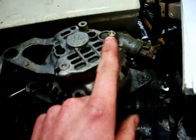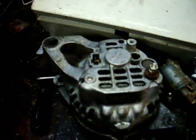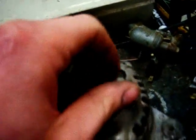For the main output cable to the battery, you need to use a heavier duty cable — something nice and thick. It has to be rated to handle whatever your alternator output is. This one's a 50 amp alternator, so you need 50 amp DC cabling. For an 80 amp alternator you'd want around 90 amp cable. Always go a bit over on your cable sizes if possible.